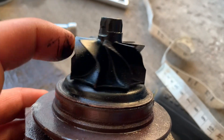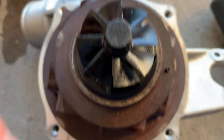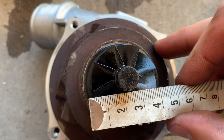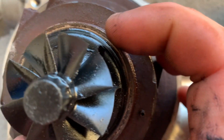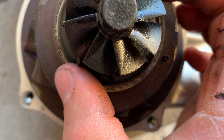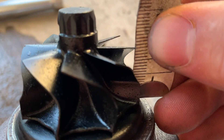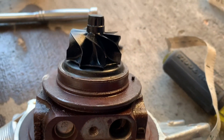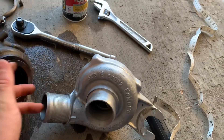Here's a good look at the turbine on the exhaust side of the turbo — it's an eight-blade turbine. Let's take a couple measurements here. The exducer looks like 37 millimeters, and the widest point of the turbine — from right here to there — is 43 millimeters. As far as blade height goes, we've got about 19 millimeters on blade height. So that's the basics of the different sizes on the turbo: inlets, outlets, exducers, inducers, everything.